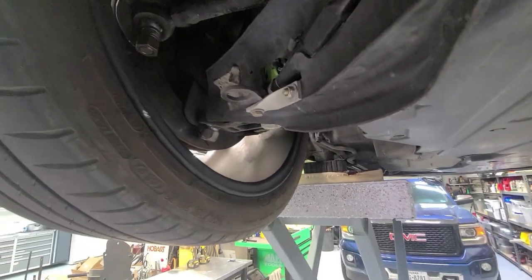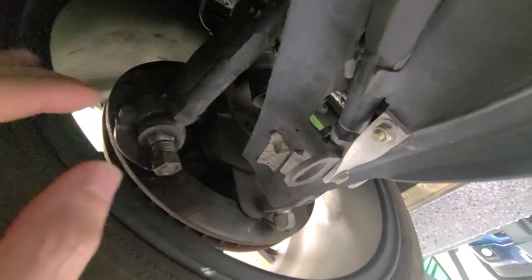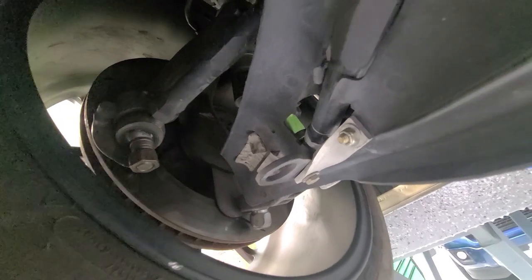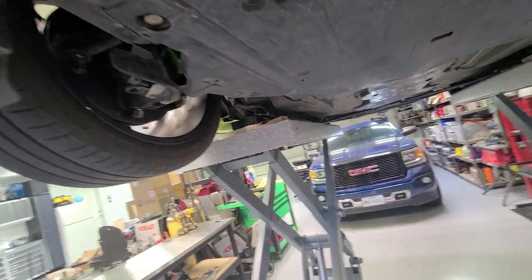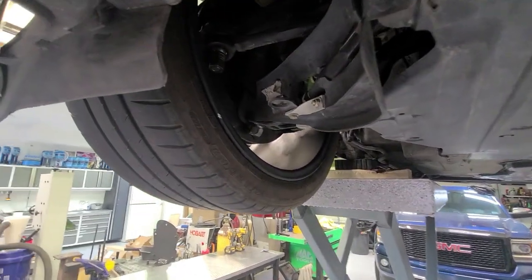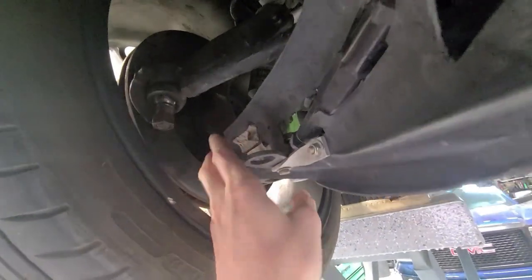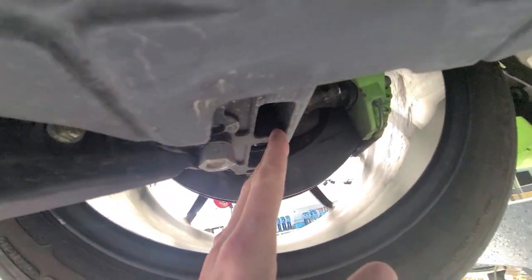You can see how dirty all this is — I do drive the car a lot. I've got bump steer correction from SPL. I basically took the wheel off, put a mirror on the hub, and bounced a laser off the mirror across the room so I could see toe change as I raised and lowered the suspension. I adjusted these parts to get bump steer down to close to zero. The car drives so much better with these parts on it.